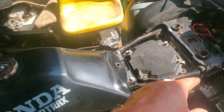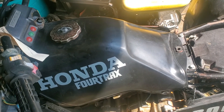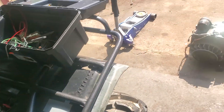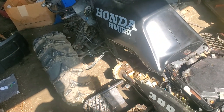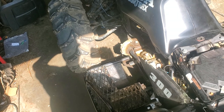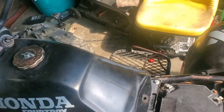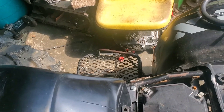We switched those out. That little test I did also showed we had the voltages we needed. So we cleaned the terminals up on the battery — that was all we needed to get proper battery voltage up to the ground on the coil. I think this machine is going to need a little extra ground overall — we'll probably pull another ground from the battery to the frame and from the frame to the engine, just for peace of mind since these machines are getting old and rusty. Finally tried it — this sucker runs! The starter circuit works, everything's working.